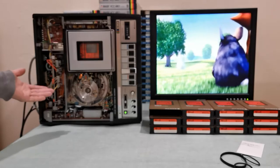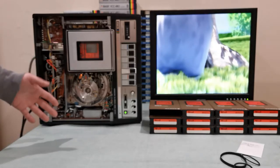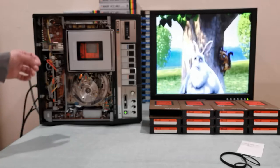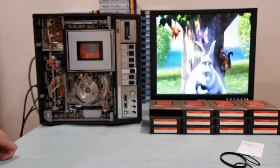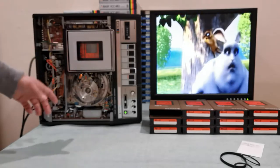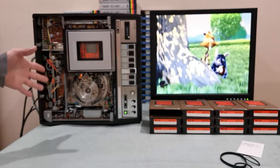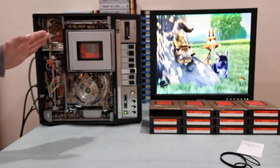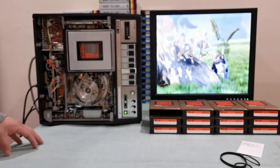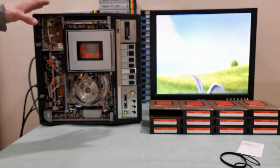They're probably not in the best shape but they're working great. If they go bad in the future I know how to test them — I have an in-line tester, so you don't have to remove the capacitors to test them; you can check the resistance in place and determine if replacement is needed. The machine being mint quality with zero hours when I purchased it really helped. My older 8200 machine, by contrast, is very scratched and worn out.